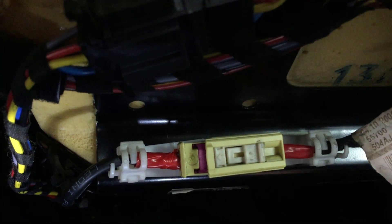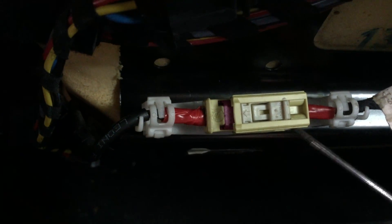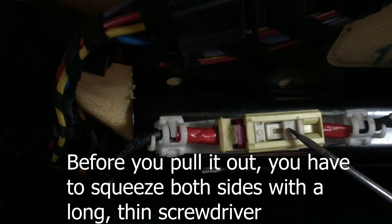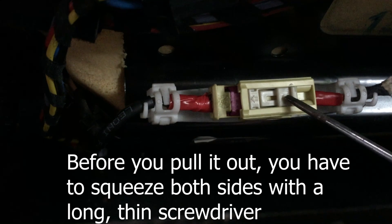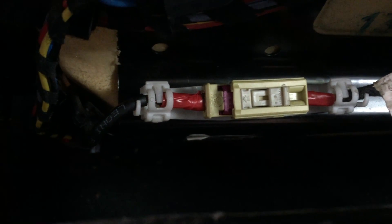I'll show you now the tabs you need to undo to take the plug out. There is one you need to open, and there is the other one. If you unplug those two, you'll be able to pull it out. On the back of the main plug there's a plastic plug that goes inside the metal frame, so that needs to be pulled out as well. On the right-hand side, slide it this way and the plug comes apart, and then you'll be able to test the wires for connection.